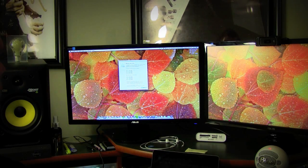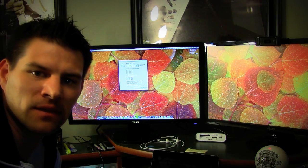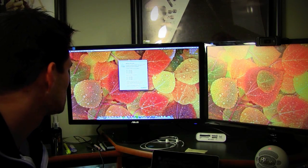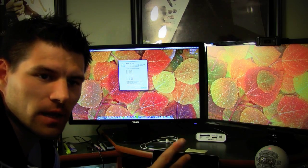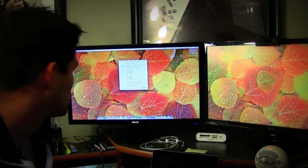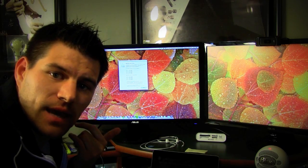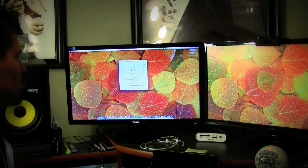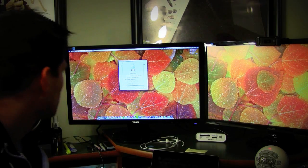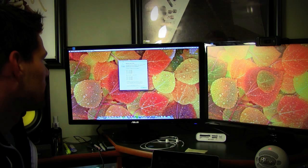Okay guys, we're back. I just got the computer started and it's telling me, alerting me, that I installed the memory modules wrong — well, actually not wrong, it just recommends for slot 1 to put the 4GB, slot 2 to put the other 4GB, and slots 3 and 4 to put the 2GB. Remember I have two 4GB and two 2GB slots. It is registering 12GB of RAM, so that's good — it actually sees it. It's just telling me that the memory modules installed are not arranged to the recommended configuration to provide optimal memory bandwidth, meaning I'm not going to get the best results the way I have it configured.